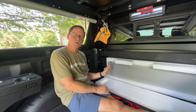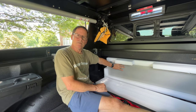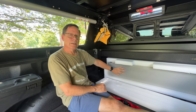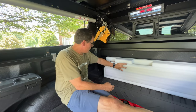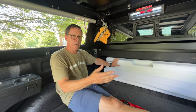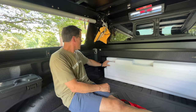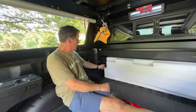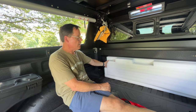I'm going to turn it on and monitor the temperature for a couple of days just by itself to make sure it stays cool. If it does, the next step is to use the other piece of packing material to completely enclose and protect the battery from rain, water, heat, and anything bumping into it. I've cut holes for the 100 amp fuse, the voltage display, and the Anderson connector on the side — everything that needs to be exposed is, and everything else is protected.